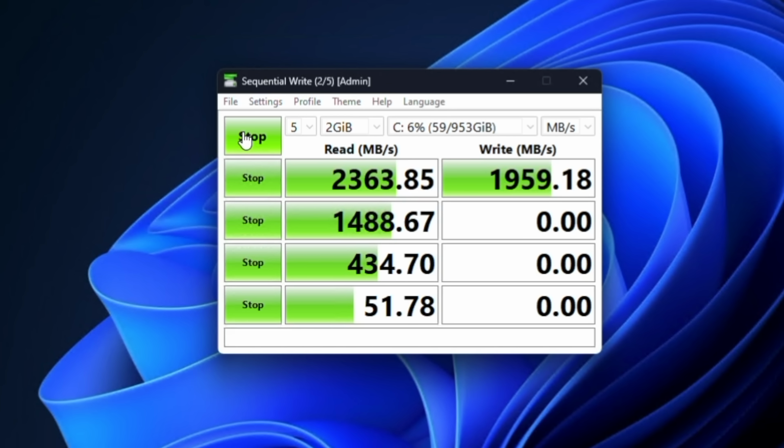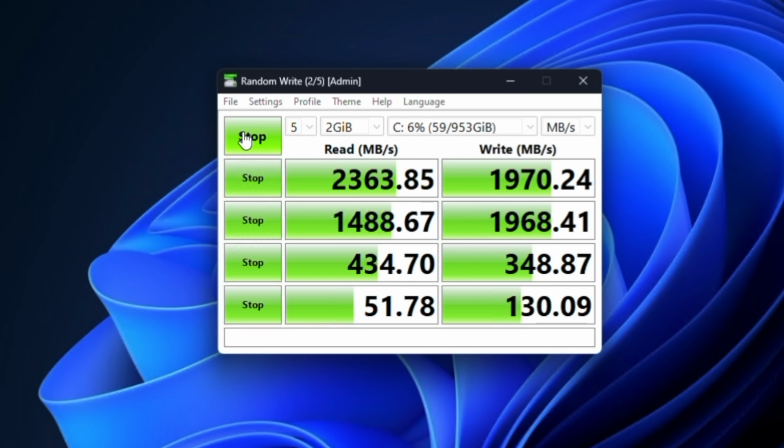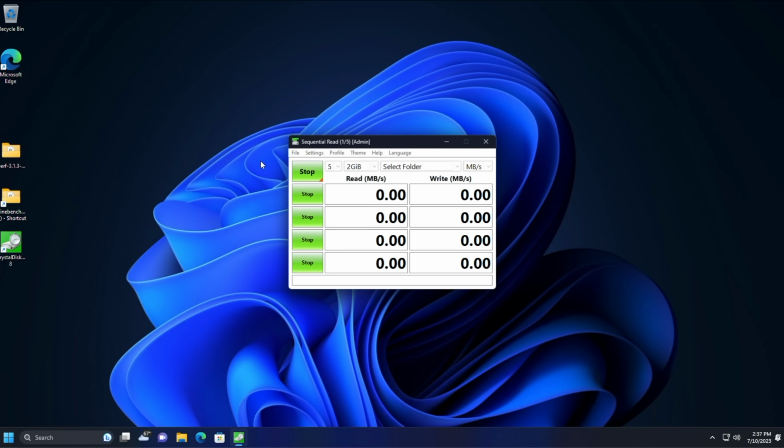Looks like it generates approximately 2 gigabytes a second on the writes, so it's not bad for a PCI 3 fairly small 1 terabyte SSD. The performance on the smallest blocks is not great, but it's better than what I've seen on a lot of other machines. Okay, for this next test, I'm going to mount a drive on my 10 gigabit NAS and we'll